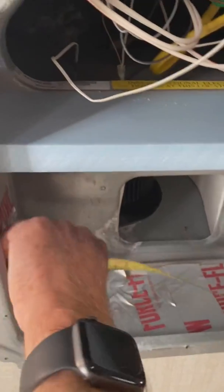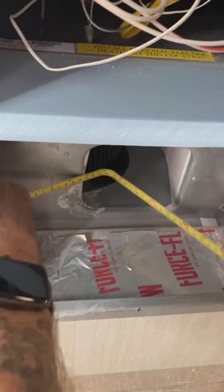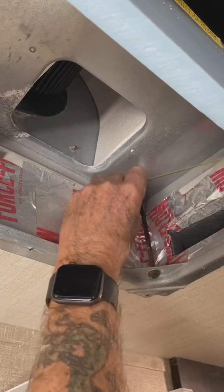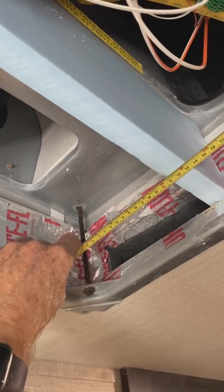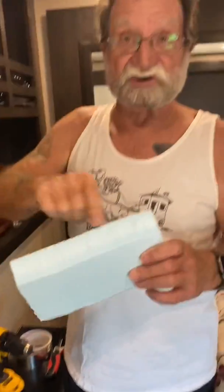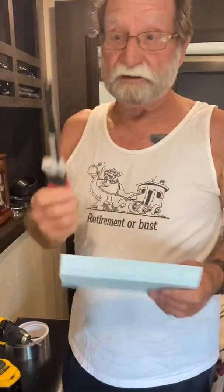This side is five and a half. This side, as you can see, is smaller — it's going to be four and a half by eight and a quarter. Now, depending on who built your camper and how this air conditioner is put in there, your dimensions may vary. I've cut these two pieces with a really steep angle so that when I put that up in there, it's flush and I can tape it. I've cut these with a little straight hacksaw blade — some people cut them with a little jigsaw. I tried to cut it with a razor knife; it doesn't work, it just chews the foam up.